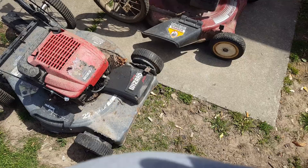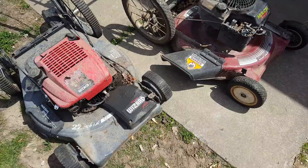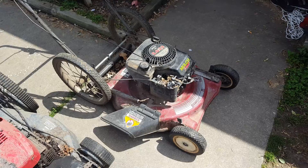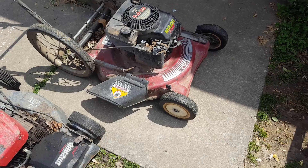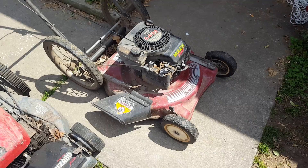I got a call this morning from my ad for free mowers and I got this one here. I haven't even tried to start this one — the pull rope's broken on it. The lady told me one of them ran but had something about an intake. The other one: if you prime it, it'll start and run for a few minutes then die. It won't stay running — carburetor, I'm sure. That's usually the case; carburetor's all junked up.